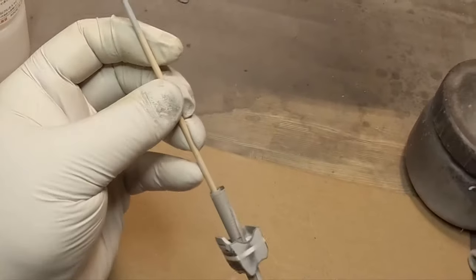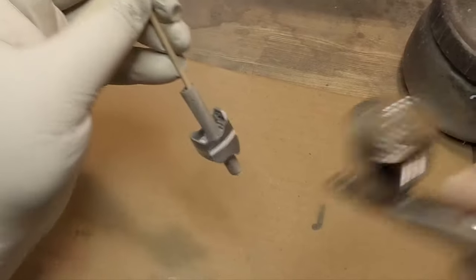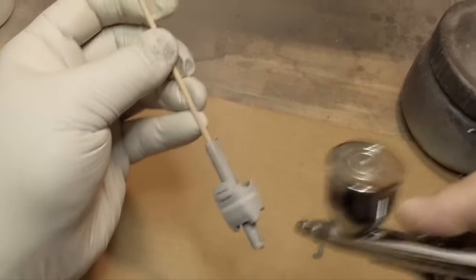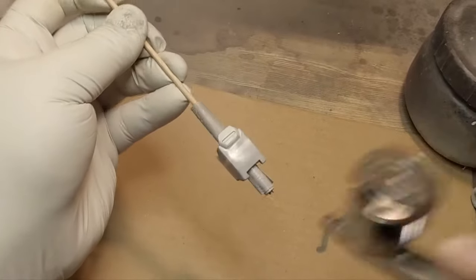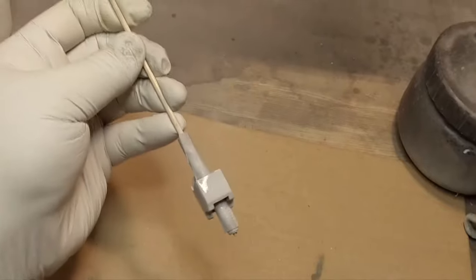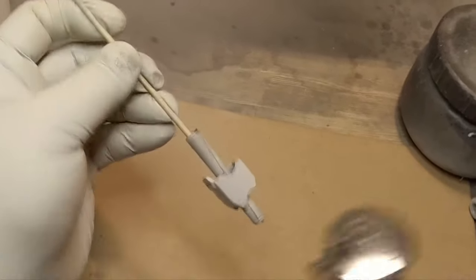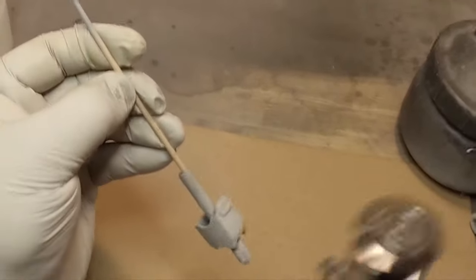This piece I've already primed and sanded down because there are some mistakes in the sanding, so I'm going to do another mist coat. I can always spray air and kind of air dry this a little bit. If I spray a little too much paint I go back to building up my primer layer. You'll notice it's just getting a wet look to it, but once this dries it will be a very flat, really dull surface. The spray technique I use is to spray fairly heavily, which gives it that wet look — and it's between this and spraying a little too much when you start getting paint to pull.